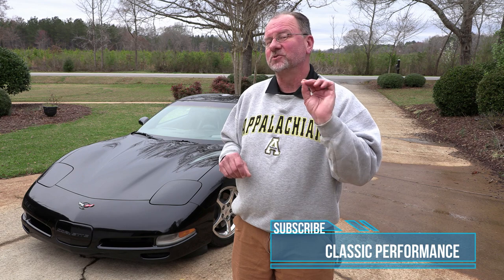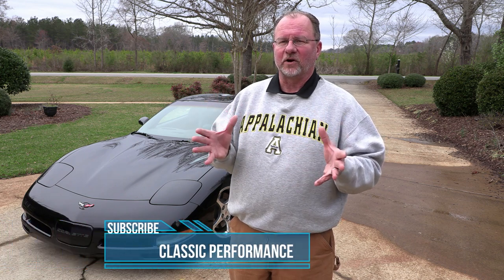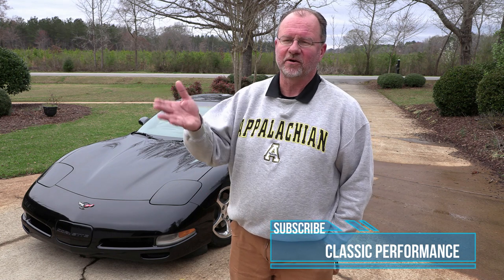It's plastic — it was cracked. So I put a new radiator in it, and when I took everything out, you can see between the AC coil in the front and the radiator itself, it was packed with grass. We got all that cleaned out with the new radiator. You can see how stuff gets trapped up in there over time because these cars pull air in from the bottom. This will improve our cooling tremendously and make the car much more reliable. A 22-year-old radiator and water pump — you should change them anyway. They're very inexpensive.